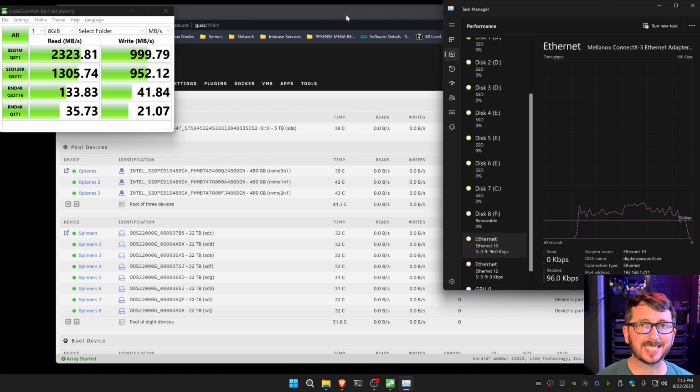And so I noticed from some testing I did when I had just two devices in there that I was actually hitting the same speed. So I think that has to do with me having a NUMA span thing going on when I moved that extra NVMe drive onto the other socket's location. That probably impacted the ability for things to stay within the same NUMA cluster, so I'm guessing that we saw some performance impacts there. This probably just has to do with the fact that if you are looking at three additional slots that are 8x on one side, and you also have a 16x slot on the other side on the R520, it may not be an optimal configuration for making sure that you have the maximum speed across those devices because they're going to be split on two different CPUs.